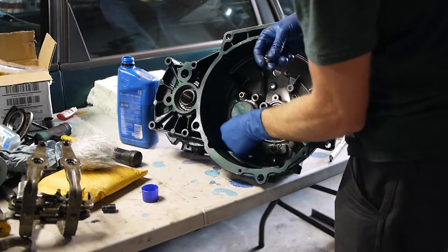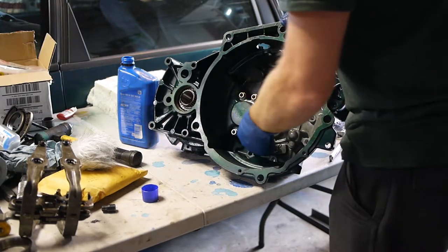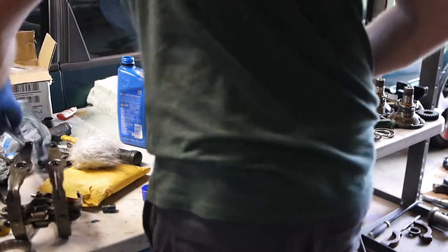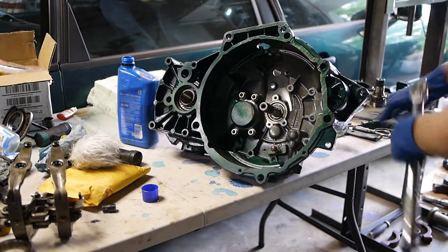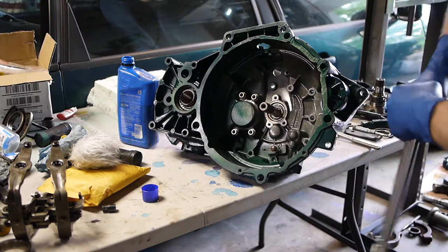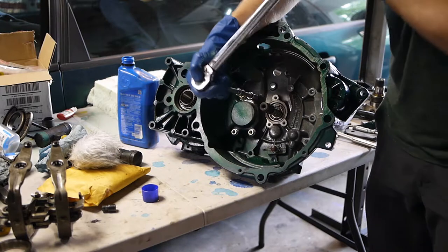I'm not a big fan of doing quarter turns, you know, unknown torque values on smaller hardware. It's something that's not really used in industry. So I don't know why Volkswagen is telling you to do it. And you probably shouldn't listen to me, but my day job, I am a nuclear QC inspector, so I deal with this kind of stuff all the time, torquing little things. We have never, ever torqued something and then turned it and made it an undisclosed torque value. Why didn't they just give us a torque value to begin with? So I'm set at 18 foot-pounds.